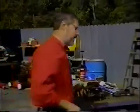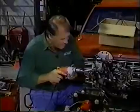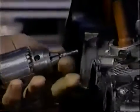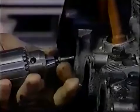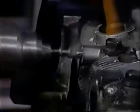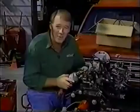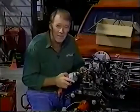We got it deep enough. Now we'll bring the collet up within a few threads of the bottom and see if we can take her out. Well, as you can see, I don't think I've ever taken a stud out any easier than that. That saves a lot of time, and what makes it nice is it does have that self-centering.